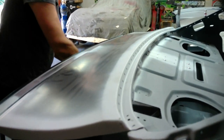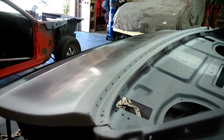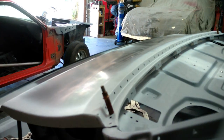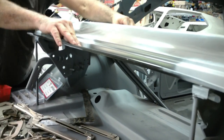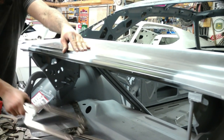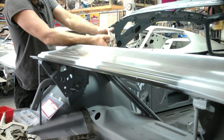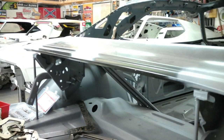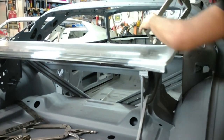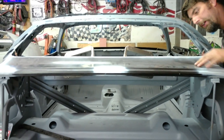One of the package tray — the deck filler panel, I believe it's called. I pre-drilled some of these holes so I know about where it's going to go. This panel is not one of the AMD panels on this car — I couldn't find one, they're out of stock. You can see it's kind of kicked up a little bit because that front bracket is wanting to push up. You're going to have to help stuff along. I want to clamp this down to make sure we're sitting flush and tight against the package tray.